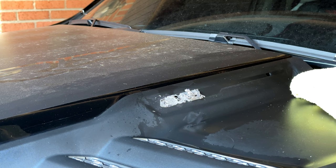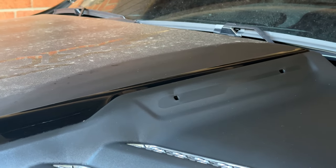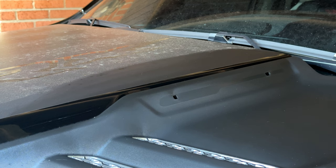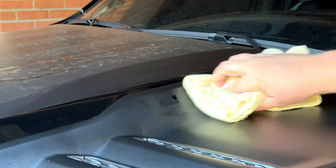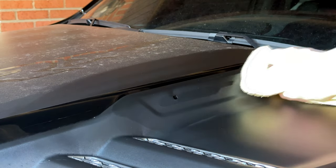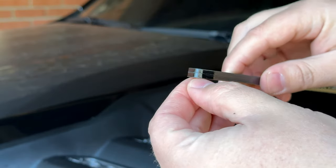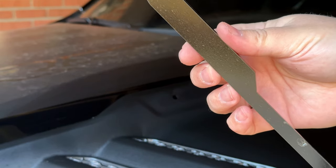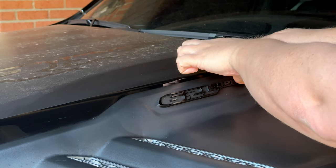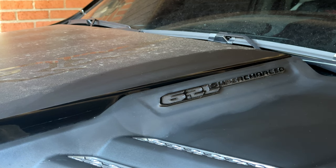Using your finger to roll up the double-sided tape residue is probably the easiest and fastest way to remove it. With everything cleaned up, you can see the outline where the emblem was — it's smooth whereas everything else is textured, so you'll know exactly where to put the new one. Before adhering anything, wipe the area down with isopropyl alcohol to make sure no goo gone is left on the surface. The new badge has double-sided tape on the back — just peel it, line it up, press it into place.